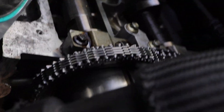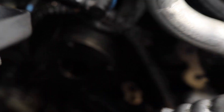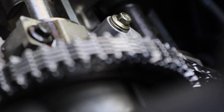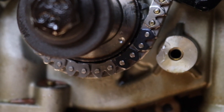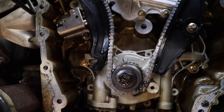And then so you can see here — on the passenger side, I got the timing chain and dot lined up there. And then on this side, you can see that I got the chain and the dot lined up on that side. And then down under here, got the dot in between the two links there. So there's a new chain, new guides, new water pump, all new gears.